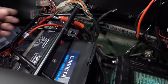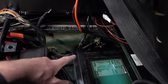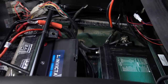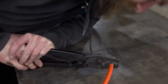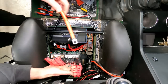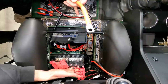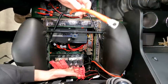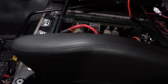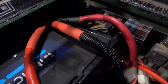Put the eyelets on these, taking the other battery terminals off - now it's just a matter of bolting everything back up. You can see the shunt for the RedVision is tucked in the corner there. Things are pretty tight in here but it works. Just made up a short line here to power some fuses - I'll do the same thing for the auxiliary battery. Off the start battery we'll have the engine, winch, and this cable for the fuse box.